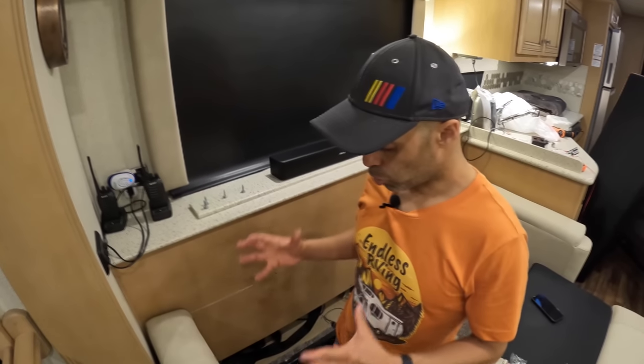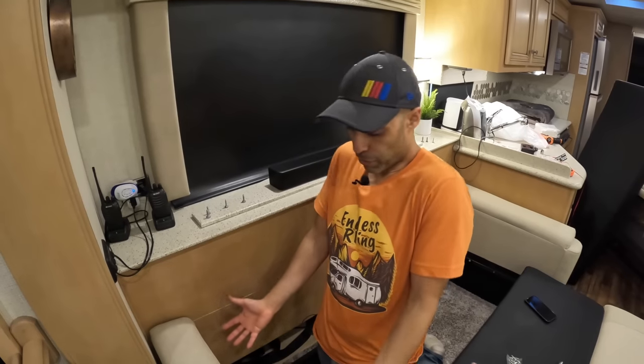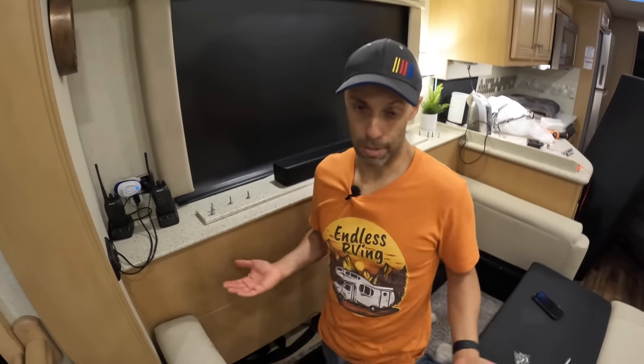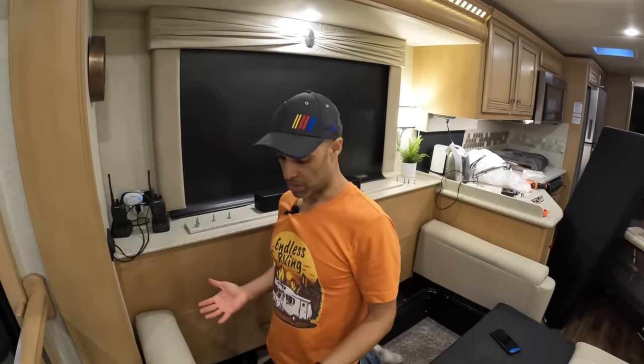How are we going to secure this? There are no stock mounting points that Thomas Payne/Lippert gives you on this furniture. I went on YouTube and found a YouTuber that does this - I'll link their channel. What they did, and what I'm going to do, is use four-and-a-half inch heavy-duty hinges. Furniture is just metal and wood with wrapping - so I'll use heavy-duty hinges, wood screws into the furniture, and lag bolts into the floor, front and rear. If I need to do all four corners, I will, but I don't think that'll be necessary.